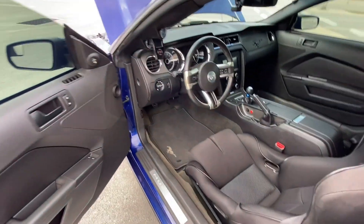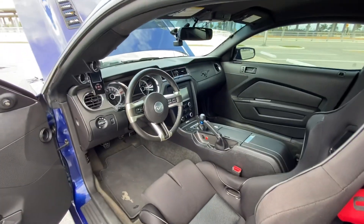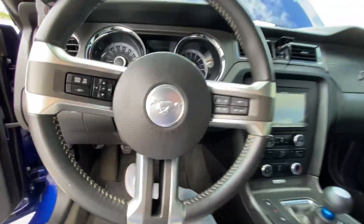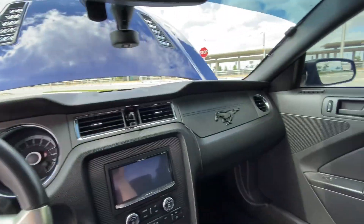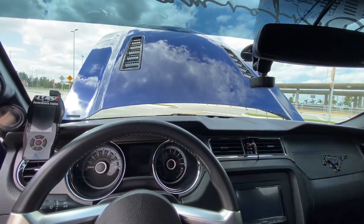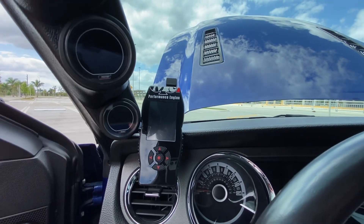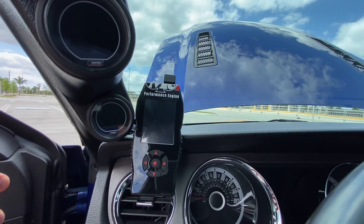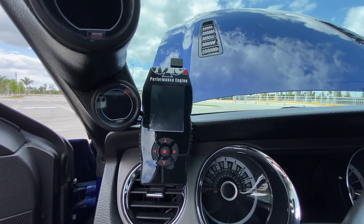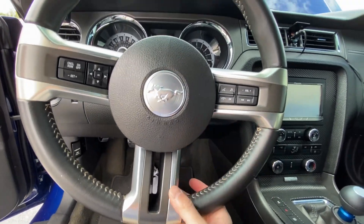This is the base car but it has racing seats — very simple but very clean inside. I love the carbon fiber accents. I put some gauges in here: a boost gauge and a fuel pressure gauge. At this power level you want to keep an eye on your fuel pressure. The moment you see that go down, you've got to let go — otherwise kaboom.